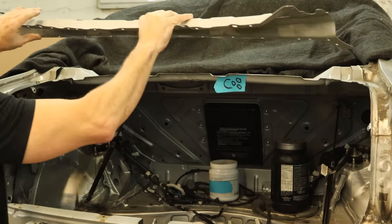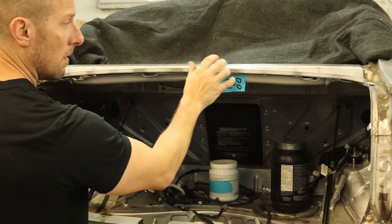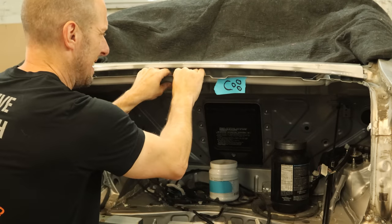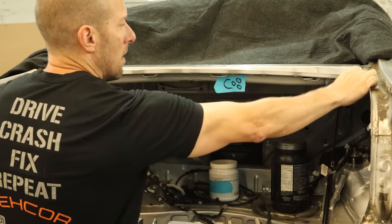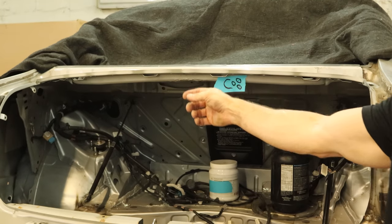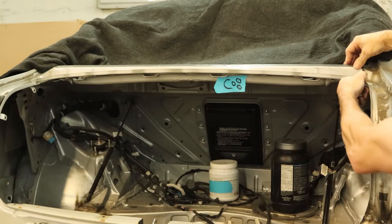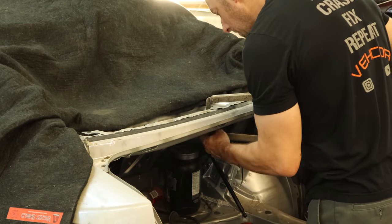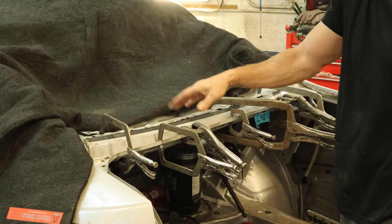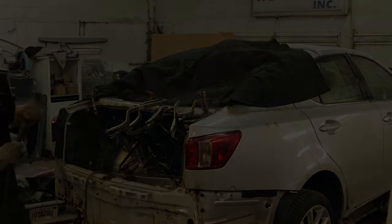We've primed the inside of this. Now we need to see if it fits. You want these two edges to touch at the same time the center does — pretty close. So we can weld it up now. I just want to make sure that I got this arc right, otherwise it won't seal on the deck lid. Doesn't matter if it has a little bit of tension on it; the ends of these might be bent a little bit. Now that it's set in place, we have our scribe line lined up and all of our holes that the factory put in there. We'll start clamping everything up and start welding — we'll weld all over the place so we don't get one area too hot. And all of our welds are done.